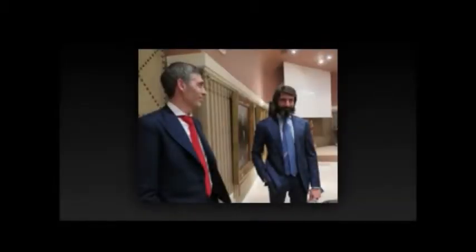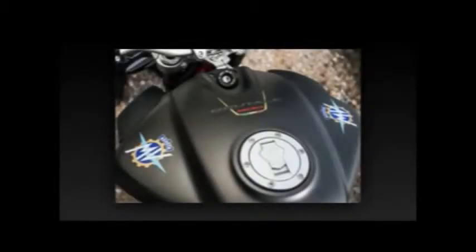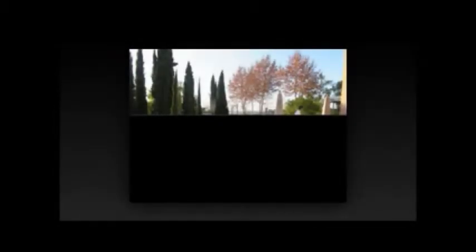Check out the hole between 5500 and 8000 RPM of the old model, blue line, that got filled in. Power delivery has also been a bit of a sticking point for MV. They finally got off/on throttle response dialed and smooth enough to satisfy everyone in the last Brutale, Rivale, and almost everyone except Sean Alexander on the Turismo Veloce, only to have to go back and do it all over again to satisfy Euro 4. What we have now, says Gillen, are completely new ECU algorithms from startup to redline to make the bike easier to ride and smoother running.